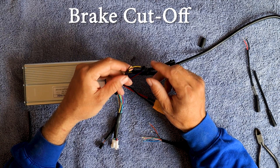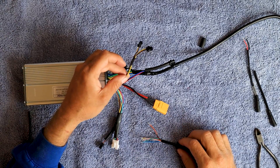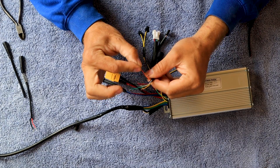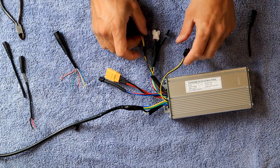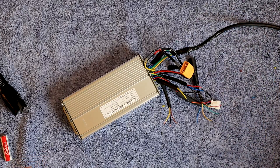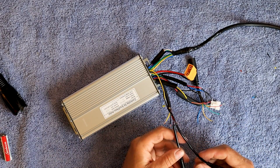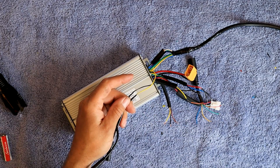So these are the brake wires here. I'm going to check and make sure both brakes run off the same wire, just in case. Yep, both brakes run off the orange one, so that splits further down the line. Orange and black are going to go to my yellow and black. Here's the final verdict: I tried using the existing pedal assist and no matter how I wired it up, it wouldn't work. I have the brake light and the headlight connected to this yellow and black wire on the controller.